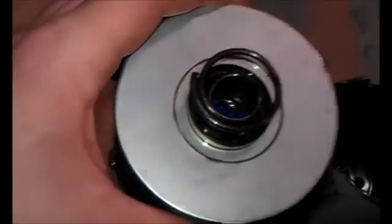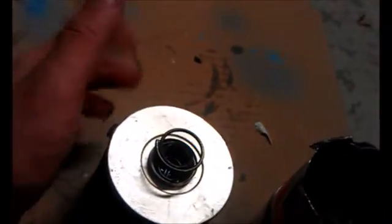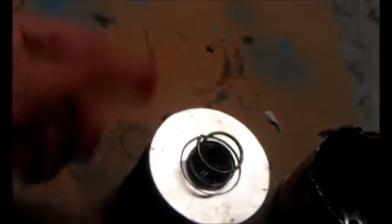You've got a PSI relief valve right there. What the PSI relief valve does is it basically relieves oil pressure when there's too much pressure going to the filter. It essentially says 'I have to let some unfiltered oil through to prevent oil starvation to the engine,' so unfiltered oil goes through making sure the engine doesn't fry itself.